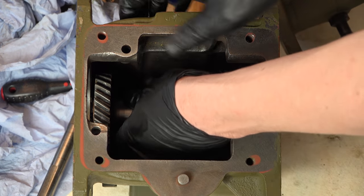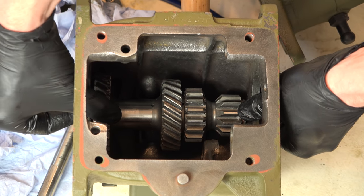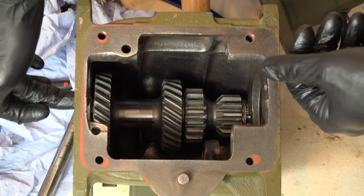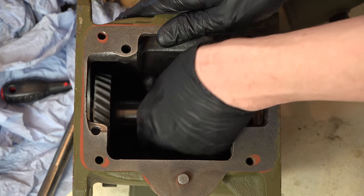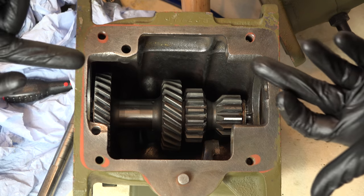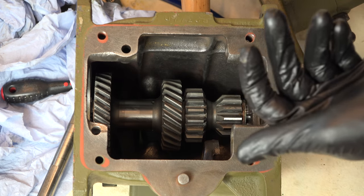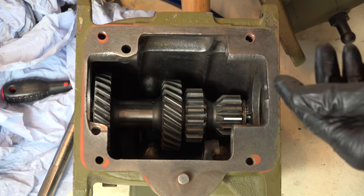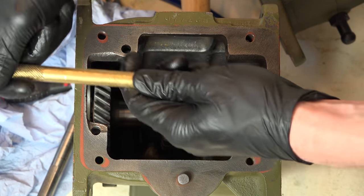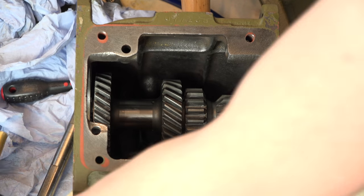The only problem now is we've got to take the shaft out a little bit and let it drop down so we can put the other gears in. I think I use this - instead of the main shaft, I push it out and use this, which is a bit smaller than the main shaft, to hold all the washers in place so the gear is able to drop down and then you can pick it back up again. She's dropped down a touch. Let's get out this brand new reverse idler gear - and when I say brand new, I mean 1960s brand new. We've got an interesting problem I didn't foresee.